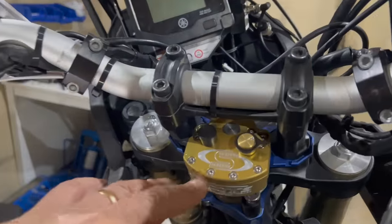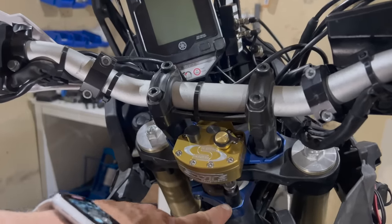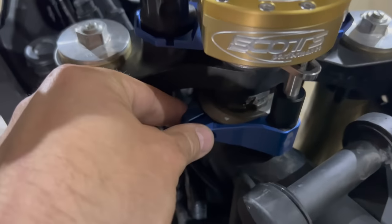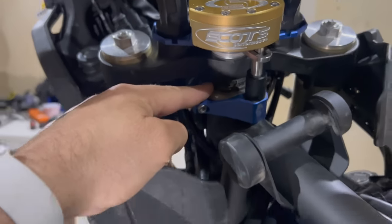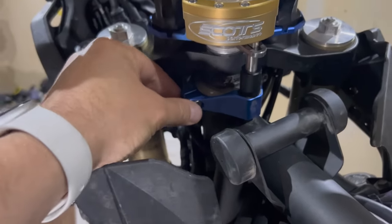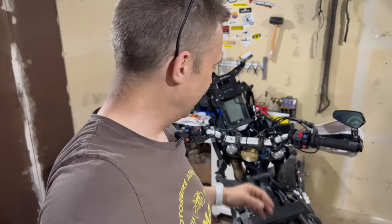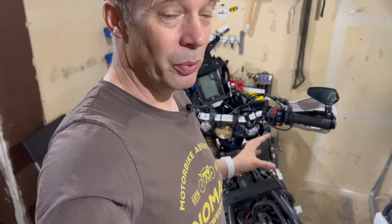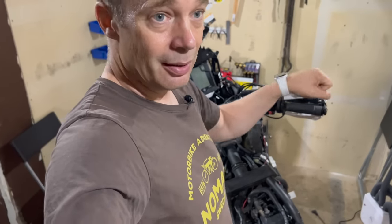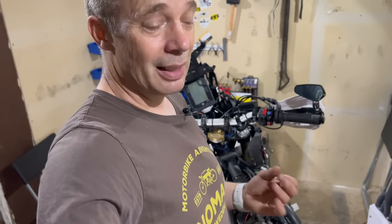And then we have the crown jewel added recently, the Scott's stabilizer steering dampener, and it's mounted with the triple clamp motor mounting kit there, because that allows you to mount it without taking off the bearings or the top nut. It just attaches here and you screw it together instead. I really noticed a difference actually. I wasn't sure, but since the T7 comes without any steering dampener at all in this standard version, it's a bit sensitive, especially if you go on rocky trails, bigger rocks or deep gravel, things like that.